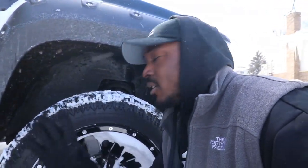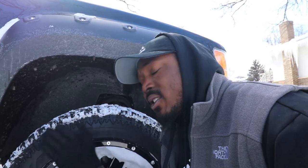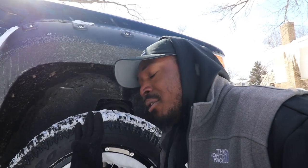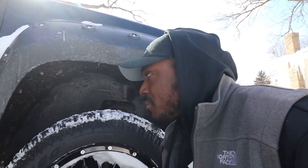And how I did it was a NorCal tuck. All right, so what a NorCal tuck is, basically it's cutting into your vehicle and modifying it to actually fit what you're trying to fit and what you're trying to accomplish with your wheel and tire setup, which means yes, you are going to have to saw into your metals and cut into your metals and push stuff back and, you know, rearrange stuff. And there's the right way to do it and the wrong way to do it.